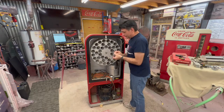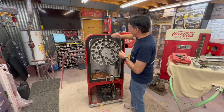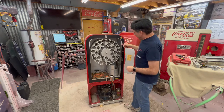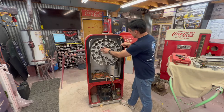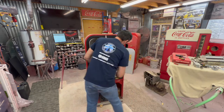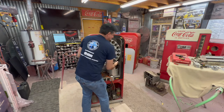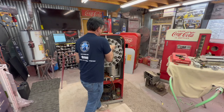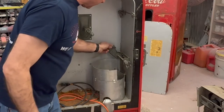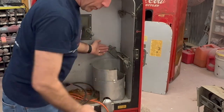Take your washers off. Make sure you hang on to this stuff — don't want to lose that. I would bag those drum parts. We're ready to take this drum out — literally that easy. You'll pull this release button, which releases the cage. There's a set of forks in the back that come through the back side. I usually turn it and the forks fold up and the drum is out.